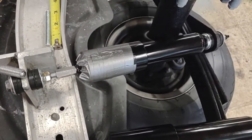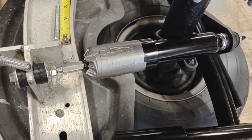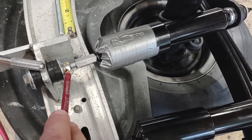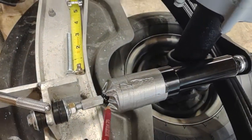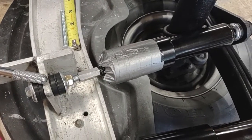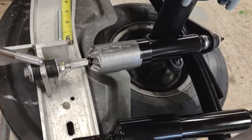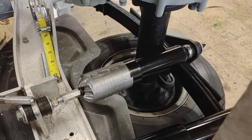And that was the easiest solution I could come up with after way too many hours of research. This was just under $5 — the screw was about a dollar twenty-five, and the jam nut was 80 cents. I looked at other options and just getting a metric coupler was anywhere from $10 to $20 each. It's nice to have standard thread and not worry about the other side. Now I've got a longer shock for a slightly elevated suspension. Hope that helps, have a good one.